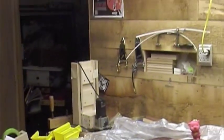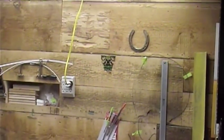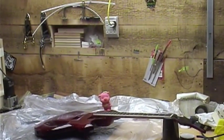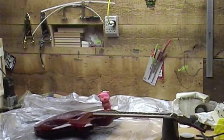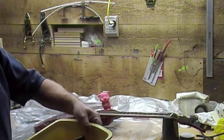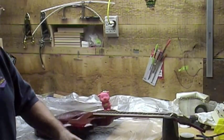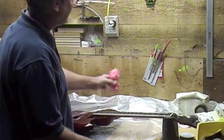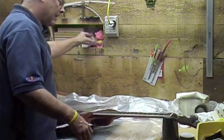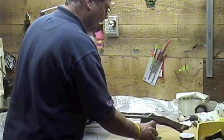Quick tour of the shot. So we're going to do this — Don sent me this forever ago and said no rush, and never tell me no rush because I'm pretty literal about that. Always take your sandpaper and put it in a bucket and let it soak for about 20 minutes — the wet and dry paper. Makes a lot of sense to do that. The reason for that is the backing becomes softer.